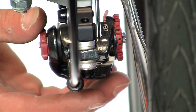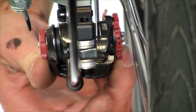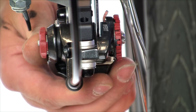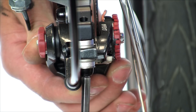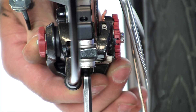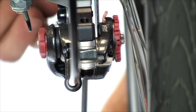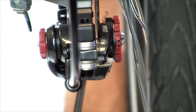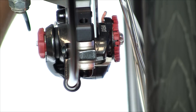To adjust your caliper's position there are two bolts with sets of beveled washers that allow you to tilt the caliper to get it parallel to the braking surface of the rotor. Just use your eyes, try to get it as even and level as possible, and slowly add tension. As you can see, when you add tension the caliper likes to move around. Hold it in place, add a small bit of tension, and rotate that tension back and forth until everything snugs down and holds itself in place. Then you can add your final torque to make sure everything stays attached.